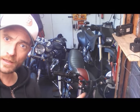Welcome back. Right, as promised, the next video will be removing the PAIR, the air injection stuff, off the DRZ, and the solenoid as well. So the first thing I've got to do for that, in preparation before I start pulling anything off here, is make up a blanking plate for the tube that comes out of the head of the engine.